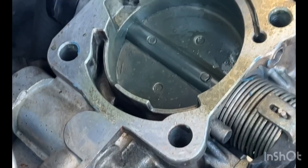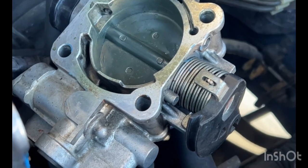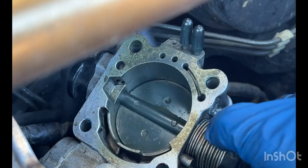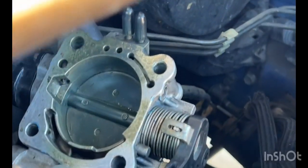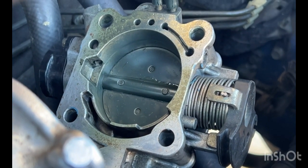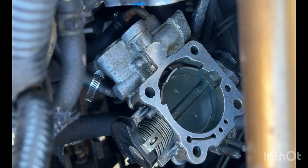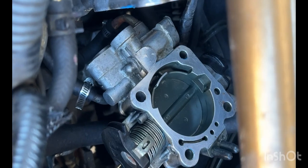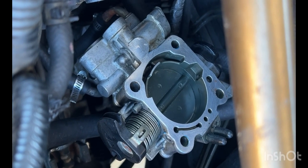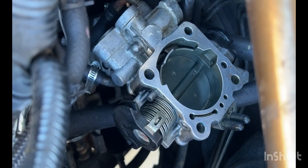This is the second coat — as you can tell there's some overspray I'm going to wipe off, but it does seem like it's actually going to stick and help get rid of the air leaks around it. I'm going to try to do a couple more coats around the edges here. If I can get rid of those little light spots, maybe this will seal up okay. Well, it's not perfect but I think I got a good layer across there. Now I'm going to install the gasket, put the throttle body back on, reattach the throttle linkage, install the intercooler pipe, the air box, and everything else, then take it for a little drive and see if it made any difference.